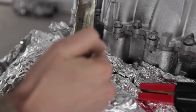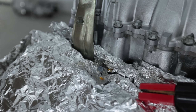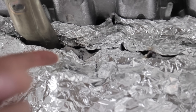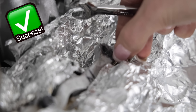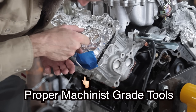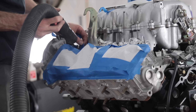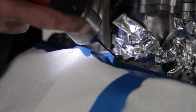I put the penetrant on the stud as fast as I could so it'll cool off the metal and shrink it back down. That's just gonna snap the nut off, I can already tell. Yep — snapped it again. It doesn't even remotely want to turn that stud. Now that I knew this was possible in theory, I didn't want to go any further with my crappy Harbor Freight tap and die set and risk breaking off a tap into the cylinder head, because then it's game over. They call a metals tech for a stuck bolt. Because I lacked proper machinist-grade tap and die set and good quality drill bits, I asked Charlie to come over and help with the tap and die extraction. If I screw one of these up, I've literally wasted nine months of having this engine rebuilt and waiting for it.